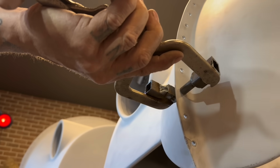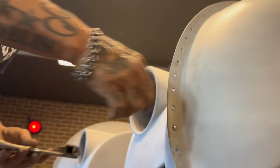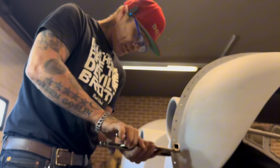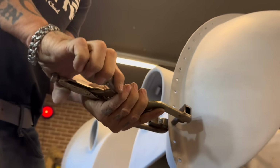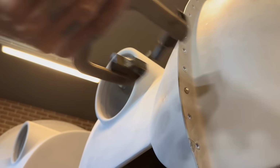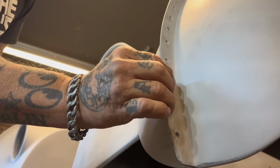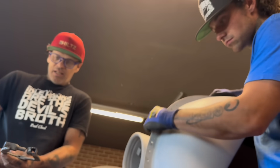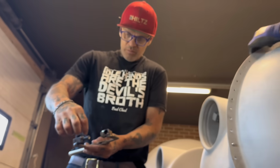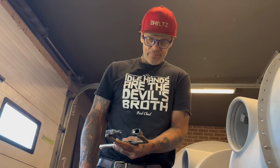What the problem is, holding the head of this rivet here tight to the metal, because when you want to squeeze it, it seems to lift up or you move, and then as soon as you crimp it, it could be stuck out here a little bit, and it makes a mess. It's off again, I have to drill it again. So basically what I'm saying is, the work that I went through making this does not work. It's not working the way I want it to.